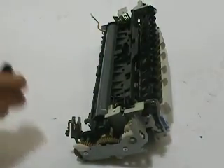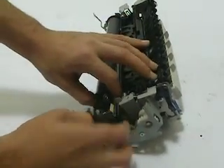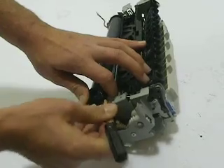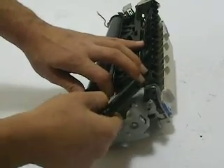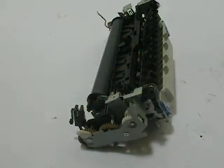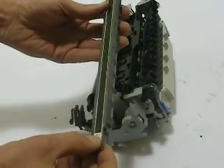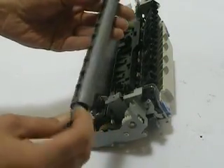At this point in time, grab your pick tool and we're going to want to lift up on that left side and remove this white tab. You're going to do that by pressing down on it — pressing downward — and this little tab actually holds the element into its socket. The element — I'm going to show you a sample here. We're looking at it this way, and it's basically going right here, and what it does is it keeps this porcelain glass element locked into its holder.